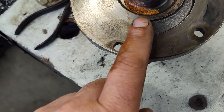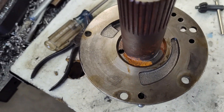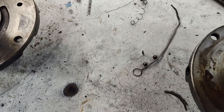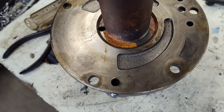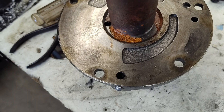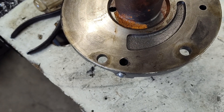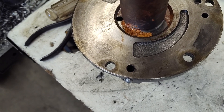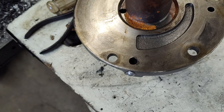You can try to open this passage up in here too if you want to, and there are some other things you can do. There is an advantage to having those balls there — when the car sits it doesn't drain the converter out. But for a performance application, removing them is important. Those two balls in there with the spring intact are restrictive, and it's fine for a factory deal, but for performance this matters.